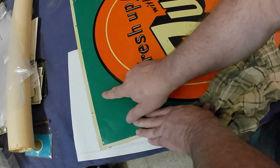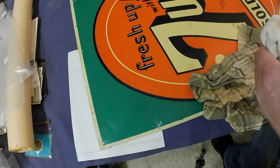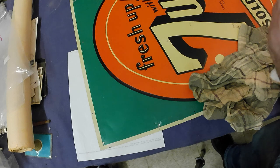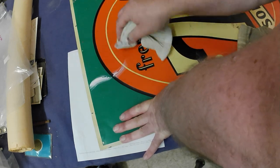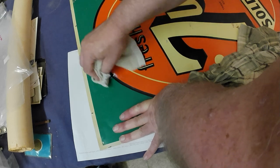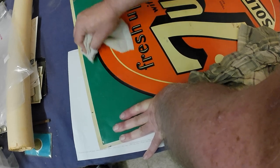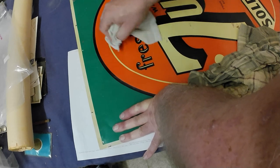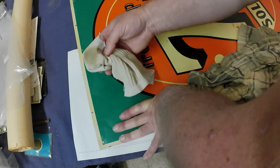We're coming up to an area — I don't know if you can see it — but there's kind of a watermark here, you can see it on an angle, so I'm going to try to buff that off. It's right down there. I'll attack it and get it cleaned off. Don't leave the polish on too long — you don't want it sitting there because it'll eventually eat through the surface. That's why I do smaller patches rather than a large patch, because otherwise the polish will be on there too long. As you can see, getting some dirt off.